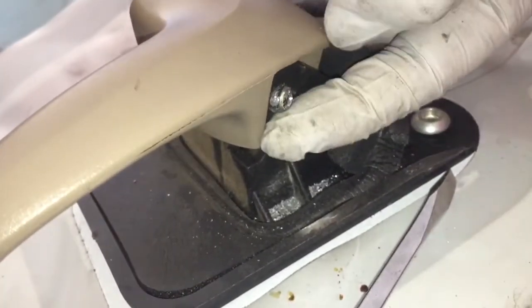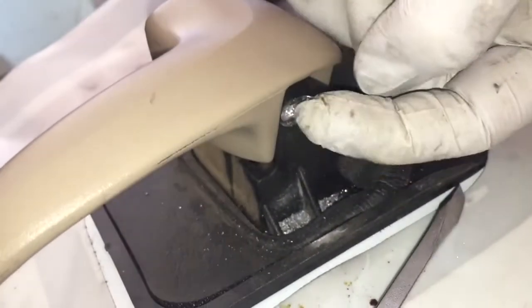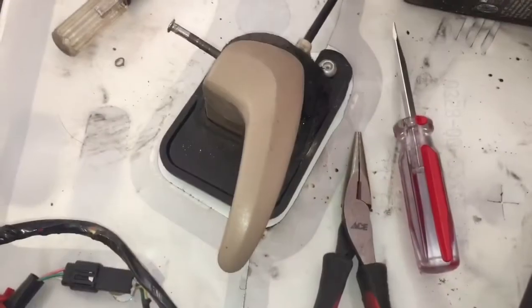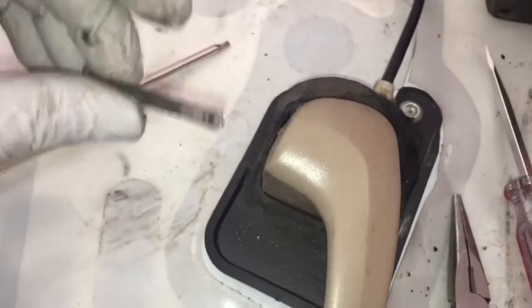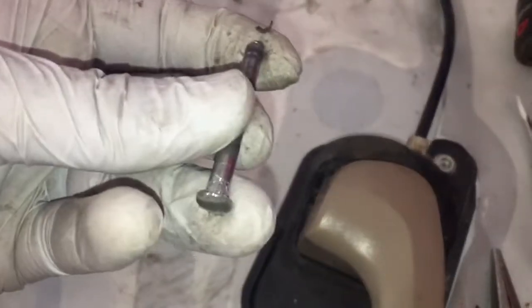By drilling it, we've been able to peel off this back layer. Now we can take a screwdriver small enough to punch it through and pull that pin out of the top. A few taps of the hammer and that pin will come out. I'm not sure you'll be able to reuse this — we might just get a bolt of the same thickness and run it through and put a nut on the end.